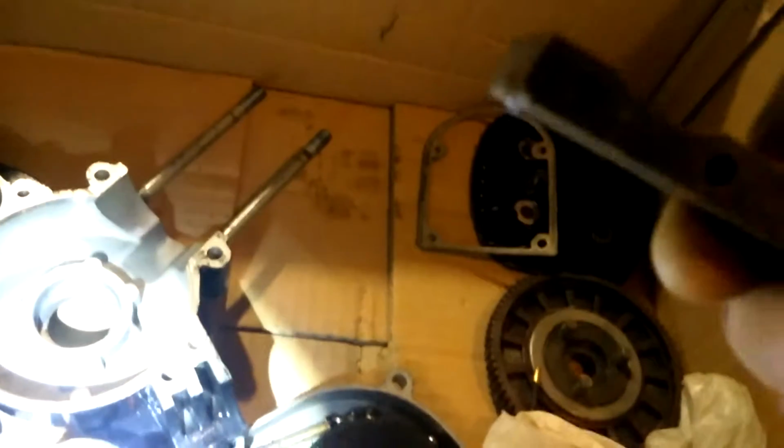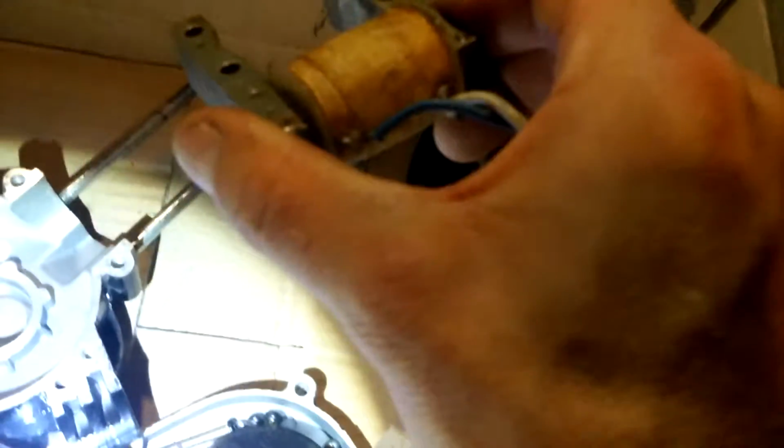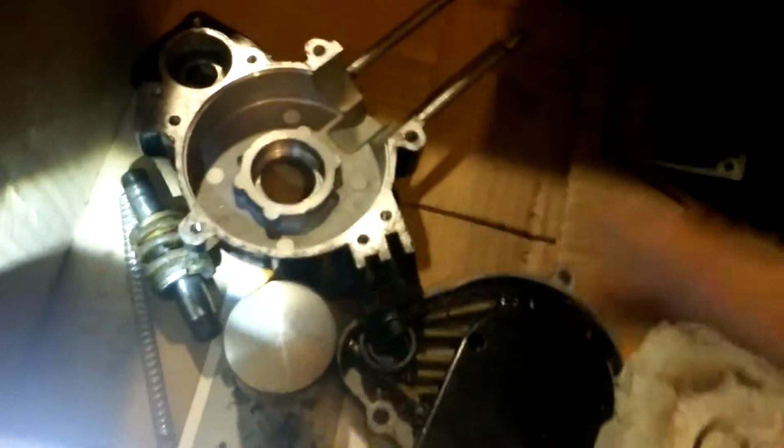Yeah, 2-wire Magneto. Brand new. Look. And look. Just like I was stating earlier, no zip tie. None. No zip tie whatsoever. And then everybody wonders why these white wire Magnetos fail. There's one of the reasons right there. Wires are bouncing around. That's no good. That's why I tell everybody, take this Magneto and ditch it.